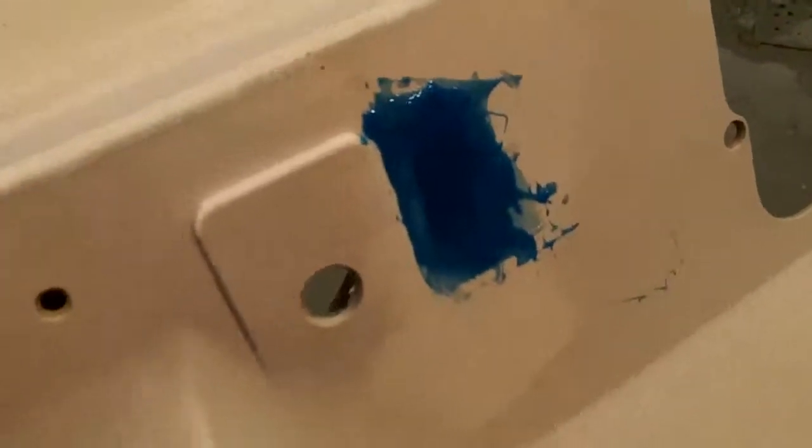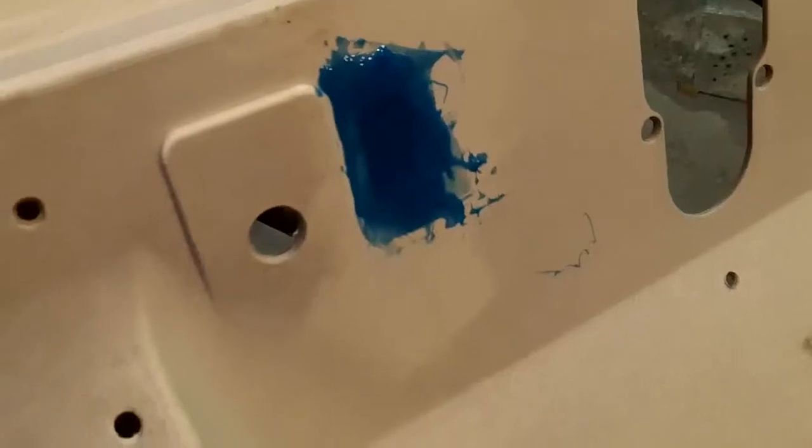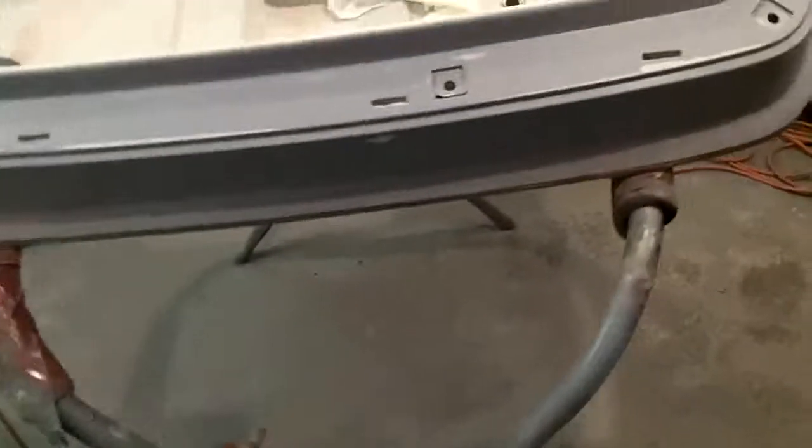I had to make some rigging up here, kind of a jig to hold everything in place, but everything else is ready for primer and paint. This piece is sanded to 400 and is ready for finish color. I haven't decided what I'm going to do with the inside yet because it is visible once it's on the cart. This is the lower part of the hood - I had one repair area here, a crack that I missed in the edge, and then there was a hole hacked in here for a switch at one point that I'm going to eliminate to clean that up. I use that 3M patching material - that stuff works awesome.